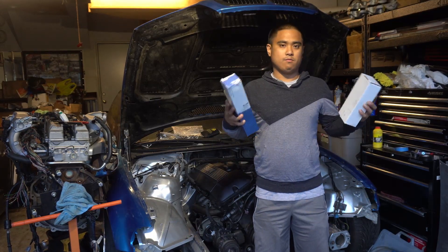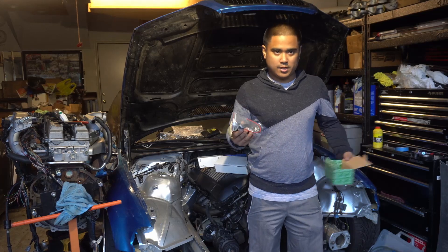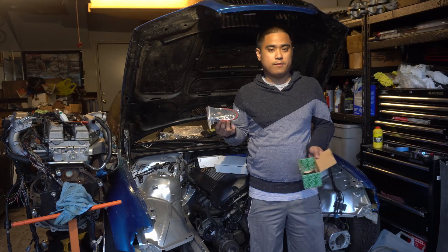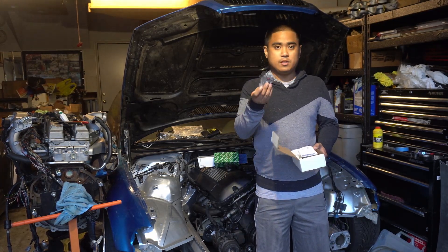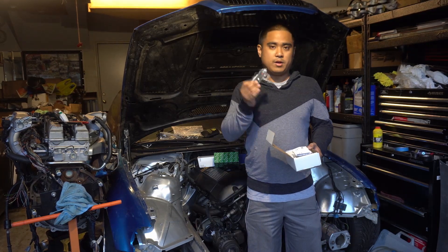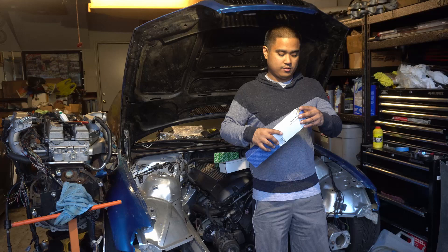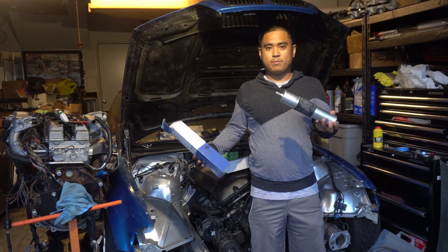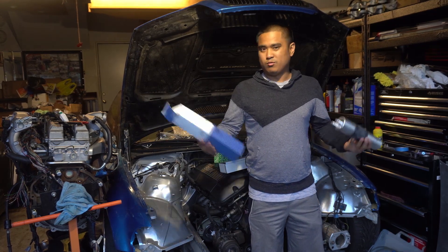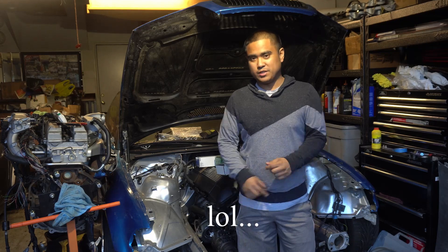One of the questions I get asked a lot for this build is what am I going to be running for fuel. I have an AEM 340 liter per hour fuel pump — used, came off my brother's S13. He decided to go E85, so this is the pump he was running before. It's not E85 compatible, but I don't intend to run E85 anyway. I've also got some Bosch EV14 Porsche GT3/GT2 injectors — 60 pound per hour injectors. I'll link them in the description. And last but not least, an OEM fuel filter slash fuel pressure regulator, which is apparently more than capable of handling 300 to 400 horsepower. Pretty simple setup.